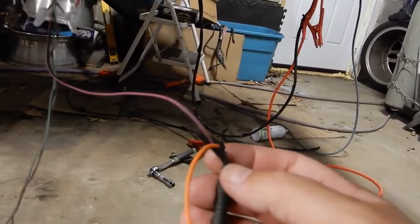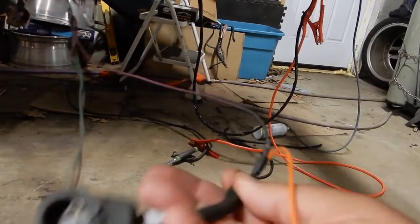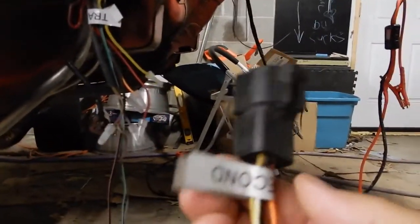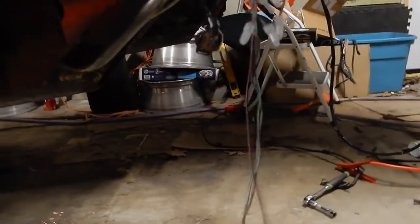When the car goes into reverse, the reverse plug gets shorted, which lights up your backup lights. Nathan explained why the output speed sensor wiring routes through a second wire — it's a signal return wire. My guess is the factory just saved wiring that way. It's annoying, but I'm going to simplify all this wiring before it's done. For the first start, it's just going to look like Frankenstein's monster.